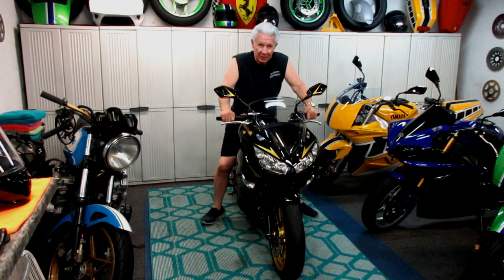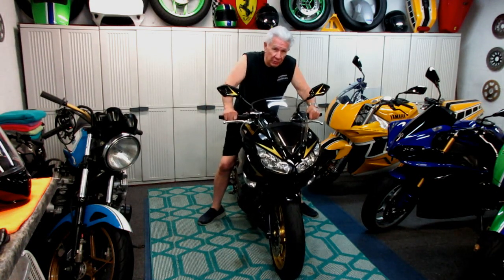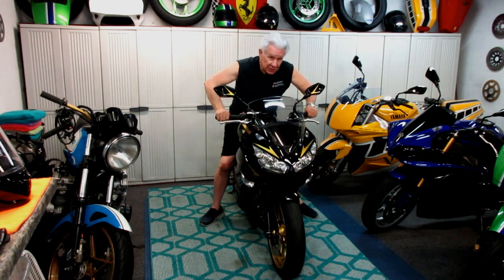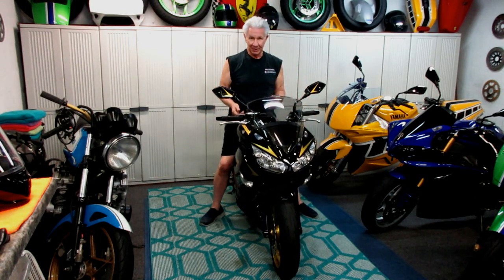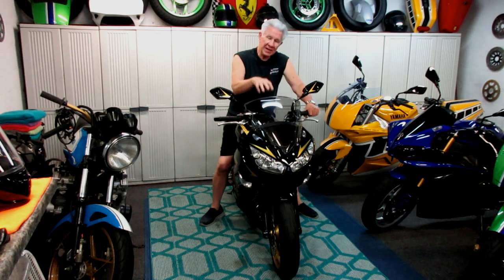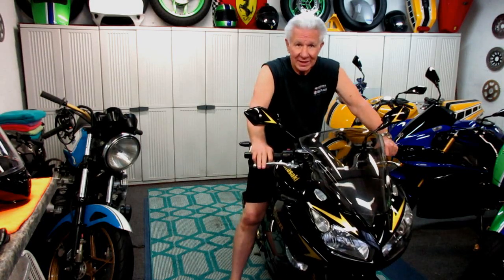Now what this is going to do — the first time I get to ride the bike it'll be much quicker on turning. From going straight to initiating a turn, it turns in quicker — it's the exact opposite of a chopper where the front end is far out and you can't turn the bike. As you lower the forks the bike gets quicker and quicker to turn. For where and how I ride — there are thousands of videos of me riding on the channel — this suits my needs. This bike has done track days at Pocono and tops out at about 125 on the straightaway. But I don't go 125 where I ride, so I'm adapting the bike to my riding style, how I ride, and where I ride.